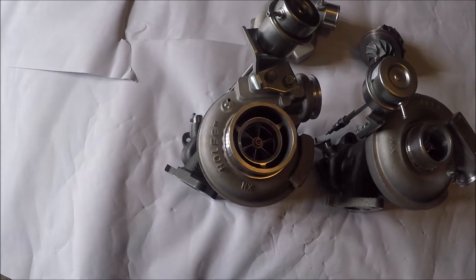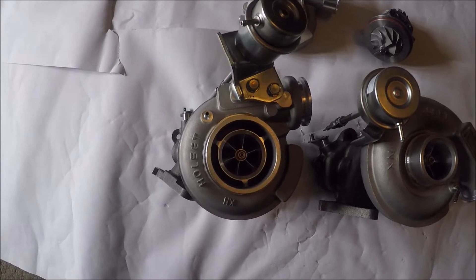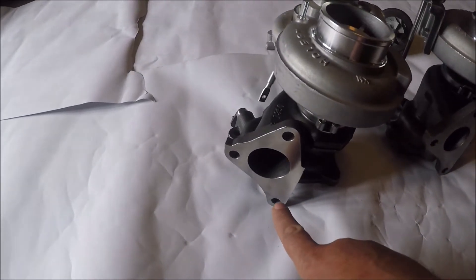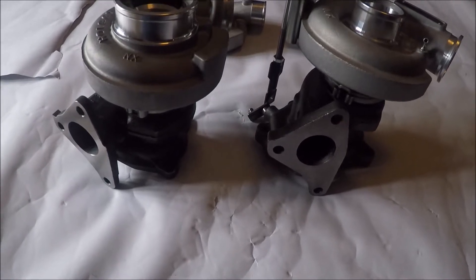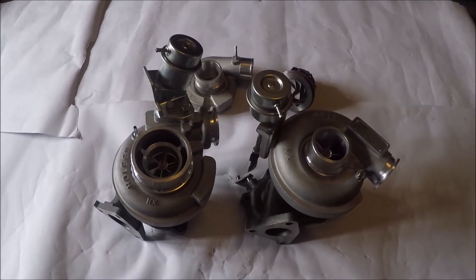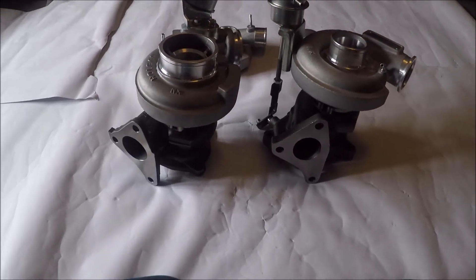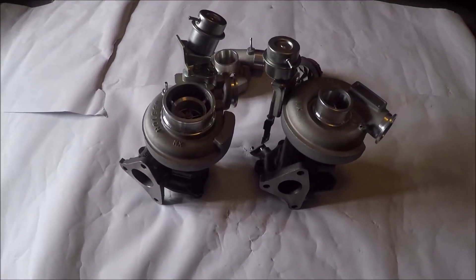This little thing here is capable of 380 brake — some people claim 400 but the compressor map shows 380. The unusual thing about it is, as you might be able to tell if you're into Subarus, these are actually direct Subaru fitment. They aren't Subaru fitment from the factory — from the factory these turbos are conventional T2 flange — but you can very easily modify them so they will be direct fit on a Subaru, as you can see here. This video is basically showing you how.